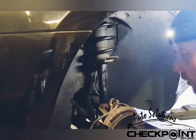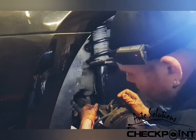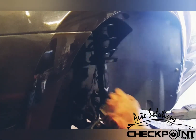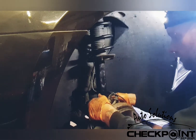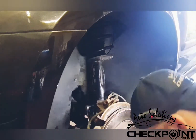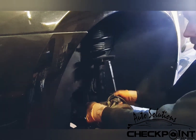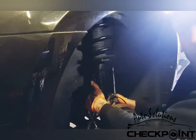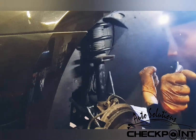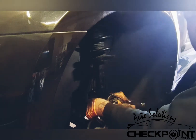Okay, that's in as far as it'll go. 19mm. You want to make sure that this is properly tight because your hub is like a clamp at the back and the clamp needs to be hugging that properly — you don't want that coming out at all, especially on rough roads or potholes. You want to make sure it's nice and tight.